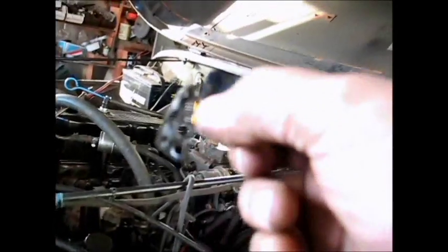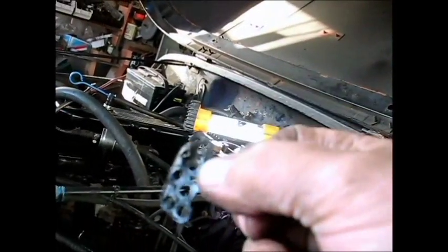I don't think I realized it, but he just about rebuilt the carburetor on the fender here. I'm taking all that stuff from the top side and working my way down. That's pretty cool — never done that before. Anyway, I'm going to squirt everything out that I can see and get to with the carburetor cleaner, and then carefully piece everything back together. I noticed the gasket on one of these looks not great, kind of swollen up.